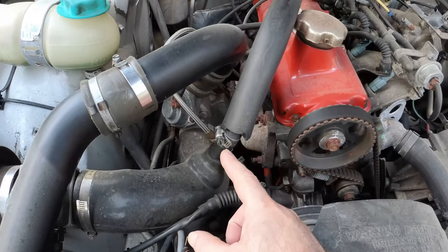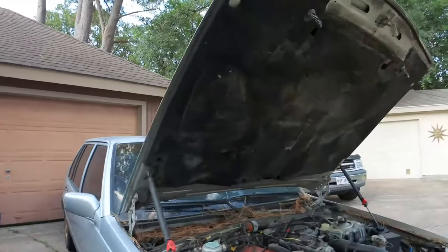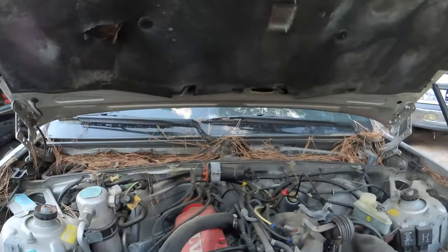It also pulls unburned gas fumes back into the motor. We had a dry-sump Fiat race car — 1.1 liter. We took the oil cap off and ran it; it lost 5 horsepower. Put the oil cap back on and gained 5 horsepower at the tires — that's a big difference. It makes more power and runs more reliably if you get that turbulence out of the crankcase.